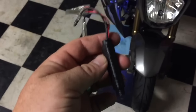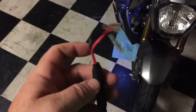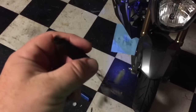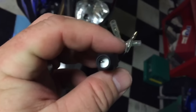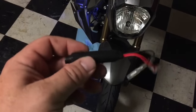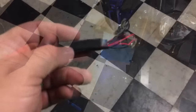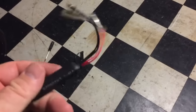We're gonna take an intermission — I'm going to cut this resistor open to find out the value. It's just a big ceramic resistor, probably with a double connection point. Actually, wait — I am stupid. I'll just measure the resistance. Hold up. Yeah, I'm not cutting anything. So this is a 10 ohm resistor. There you go — this little bad boy is 10 ohms. That's all there is to it.